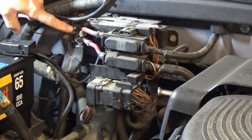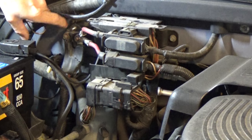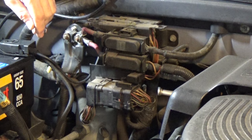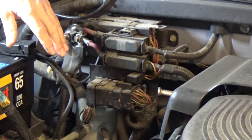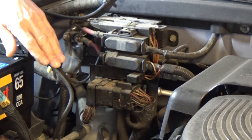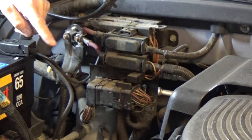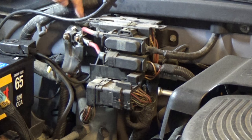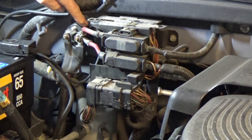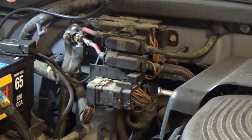What we need to do is take this off. What happened here — this is the original — this is a '97 model, so it's pretty old, this solenoid. If you need to know how to replace the starter, I have a video on that where I do voltage drop tests — that's the correct way to verify that it is the starter. What I suggest is maybe replace this solenoid with a good quality one — not a crappy one — when you do your starter. These are about $25 aftermarket and about $30–$35 for an OEM Motorcraft.